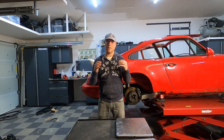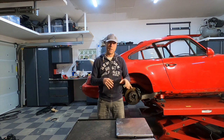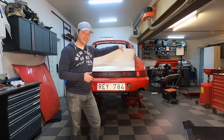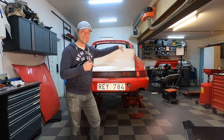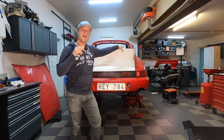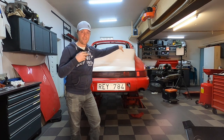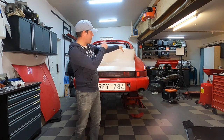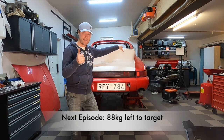I'm not taking anything into account for the fuel tank — I think the two setups are about the same weight. The question is whether I want to move the tank forward and lower down to improve the handling a little bit. I'm happy to take feedback on that. That is the end for today. We started with 123 kilos left to the target, we found 35 kilos looking at brakes, fuel system, ventilation system, bracketing, harnessing, and fluid tanks, meaning next episode we have 88 kilos left to go to the target. If you like what I'm doing here, please subscribe to my channel. Next time we're going to go after either the carbon fiber panels and doors, or take the four-wheel drive out. Thank you very much.